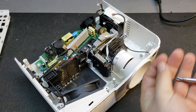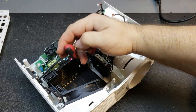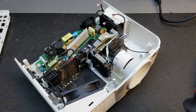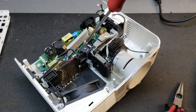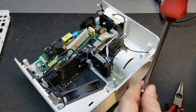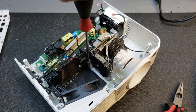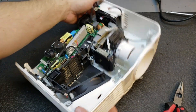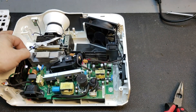We'll put this screw back in. It's a little hard to get in there — I don't want to lose the screw. It's a little tough to get down in there; these screws do not seem to be magnetic. I must have demagnetized my screwdriver at some point — it did get hot. Something was bumping the screwdriver out of position there. The fan is back in position. We should plug the thermal sensor back in because there's no reason to have that unplugged.